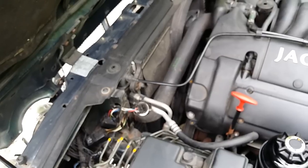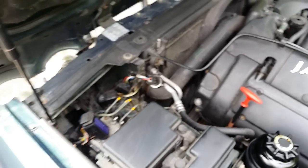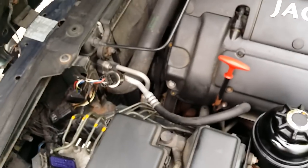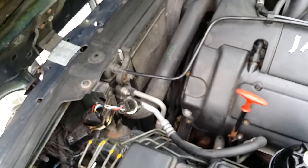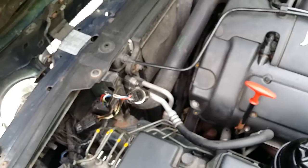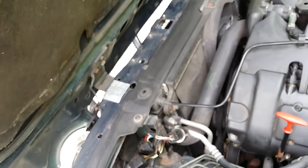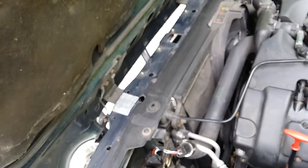At each wheel, in removing each wheel, I took the sensors out from the hubs and cleaned them up. The rears I'd already done that and swapped over to some new sensors — still it was faulty. So I moved on to the front. The front sensors are slightly different to the backs; they sit on the hub and read the toothed gear wheel behind. When I took those out on the front, I noticed they were slightly dirty and had picked up rust particles which were sticking to them. So I took those out and gave them a clean with a rag and some WD-40, and also wire-brushed the cog behind the hub with a fine copper brush.